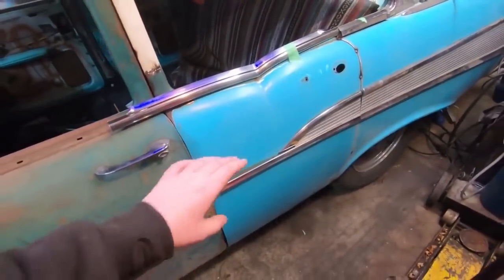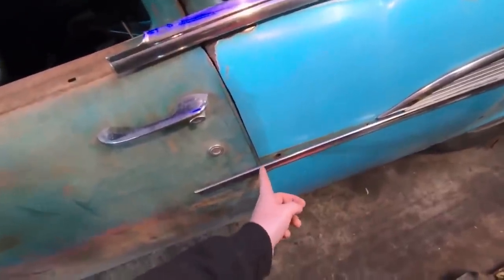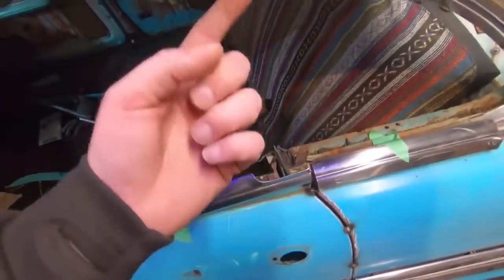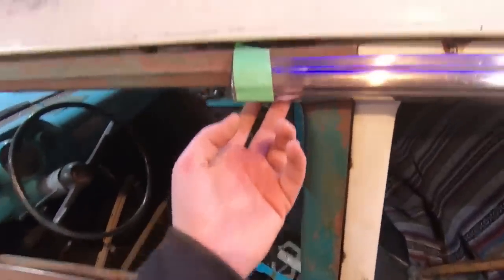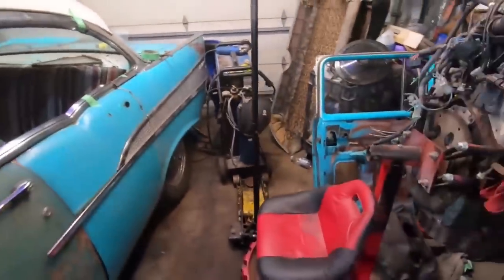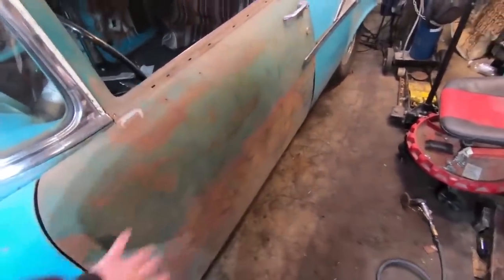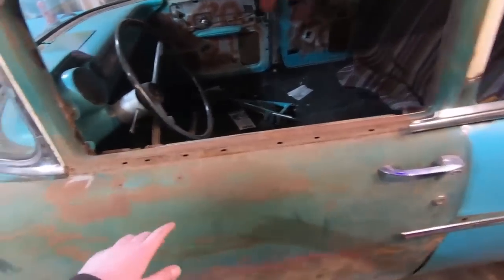This is the trim off the door, which I chopped down — you can tell how much you take out. This one's easy — slip it, pull it back a little bit. The same thing on the other side, and I should be able to buzzer it down there. We'll fill in this area, and there's one underneath as well. Same up front — it's got this little slip where the door would have been. I'm going to leave it probably as a couple of pieces. Cruising down the road I think it'll be fine. For the front here I might actually break down and buy the piece. I have a whole second set of trims — my hope is I can put them together, weld them, and polish them.